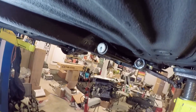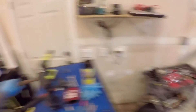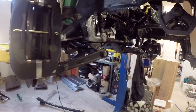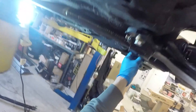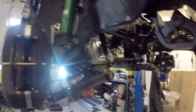If you have a Civic and not a CRX, and your car has short torsion tubes, you can still install these CRX torsion bars, but you'll find there's about a quarter of an inch or less of space between the clip and the back of the tube — that's okay. It won't hurt anything and you should still be able to get the cap on the end of the tube. Once these are in the car and on the ground, they're under torsion and won't be moving at all. So this is how you install torsion bars in a Civic, CRX, or Integra — re-indexing by moving the suspension up, setting the height at the adjustment nut, then driving the torsion bar in after removing a spline from the back end.